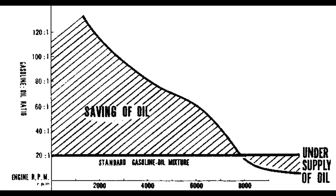If you look at two-stroke forums you will see that people use a pre-mix ratio of 20:1, which means for every liter of fuel you add 50 ml of oil. But if you look at the graph provided by Yamaha, you can see that the engine requires a lot less oil than 20:1 at lower RPM and a lot more oil than 20:1 at higher RPM. Giving a constant ratio of oil at both low and high RPM can lead to a lot of smoke and also engine seizure.